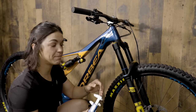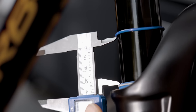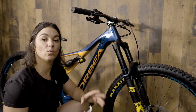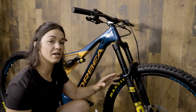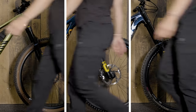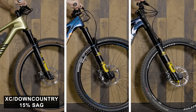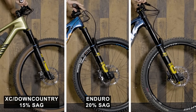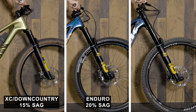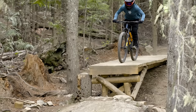Measure the distance between the bottom of the o-ring and the top of the seal, then work out what percentage that number is of the total travel. On shorter travel bikes you could have as little as 15% sag; trail and enduro bikes as much as 20%; and for a soft, ground-hugging downhill fork, some people go as much as 25% sag. A good base is about 20%.